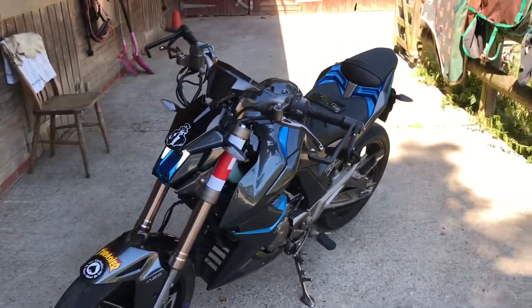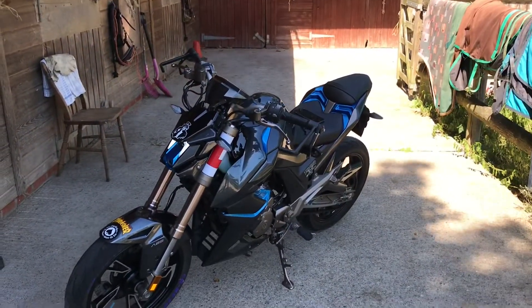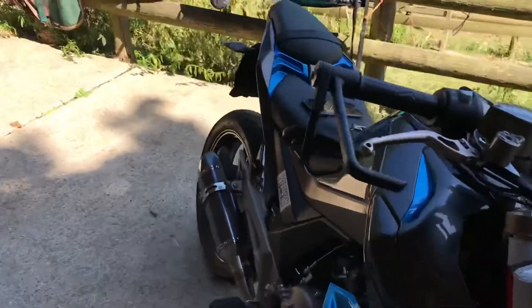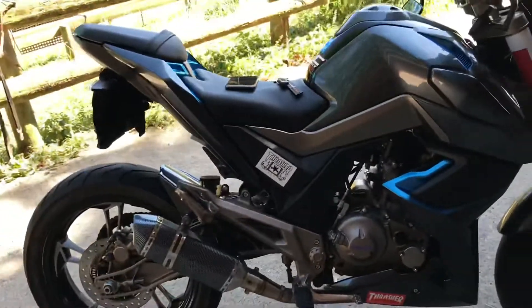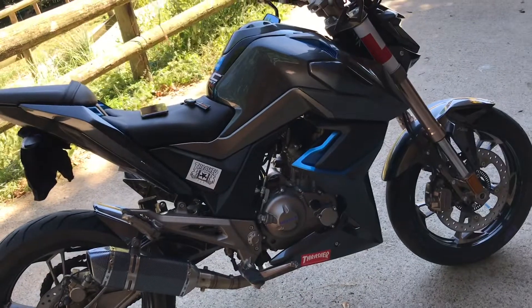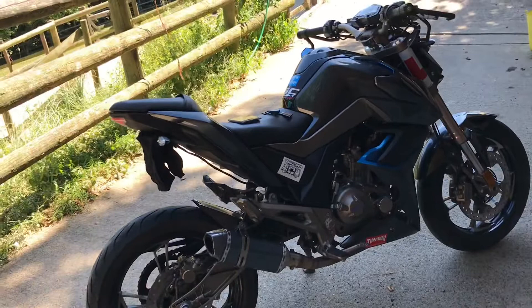What also used to happen is when I wash the bike sometimes, it gets water on the HT lead and it doesn't like it. Sometimes it sits there popping and cracking — because I've got an aftermarket exhaust — and coughs and spits after washing because water gets in on the HT lead and spark plug. Usually I've got to take the cap off, give it a little dry, and then it's all right. Every now and then I'd take off the spark plug cap, give it a clean, then it'd be fine — I'd put it in gear and ride away. But then there'd be other times where it just kept doing it three or four times in a row.